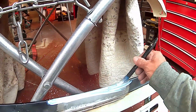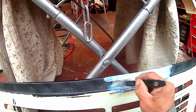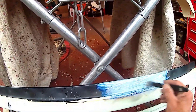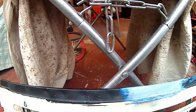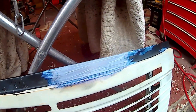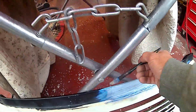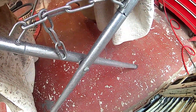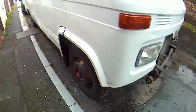I'm going to put a little bit of Actan on this plate just to protect it until it gets to the painter — just stops the metal rusting. Because the painter will obviously be putting filler and whatnot on it, so I don't want to put primer on. The filler prefers to go onto bare metal. There are little pits where the spot welds are between the two sections of metal, so I'll let him deal with that. I don't want to step on his toes and how he likes to prepare things — everybody does it different.